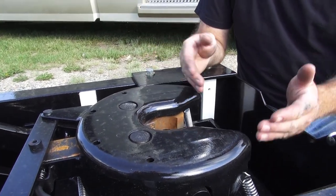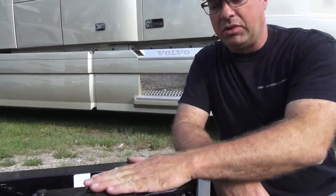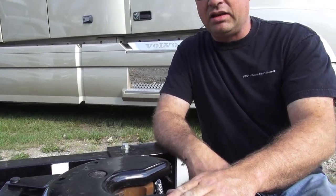As a result, it does some unique things. We're going to connect a trailer and disconnect a trailer, and I'm going to show you the one important thing — which is to establish a little gap between the plate of your trailer and this hitch head when you disconnect and when you connect. Let's go do that on a real truck.